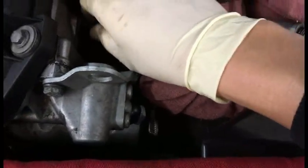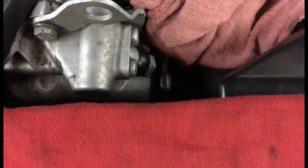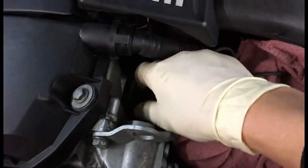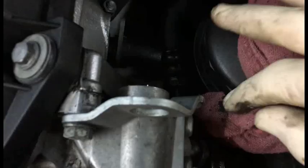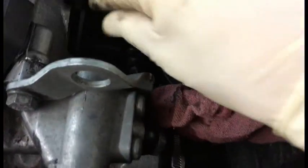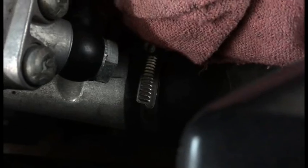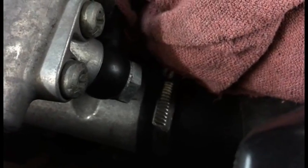There shouldn't be a gasket. There should just be, whatchamacallit. Well, there will be a rubber gasket, but not a paper gasket like I thought. So, okay. Now this is going to be interesting because this won't come out unless I take off the Vanos line, probably. Bolt there. I think that's a 17. And they use a crush washer, so just take out that.